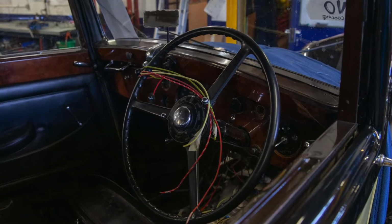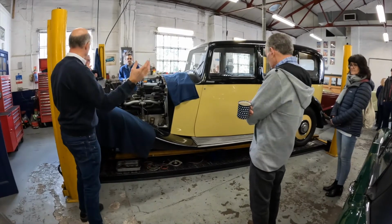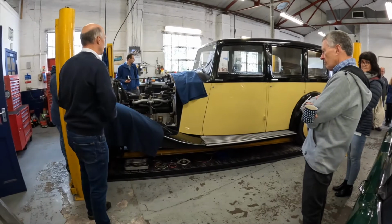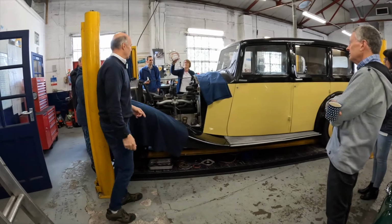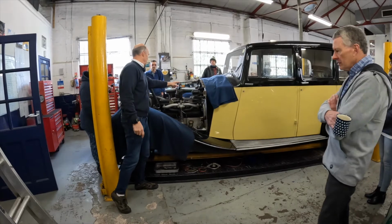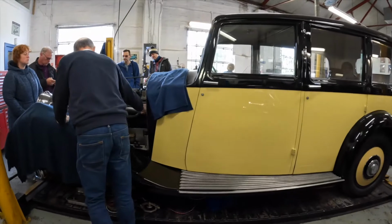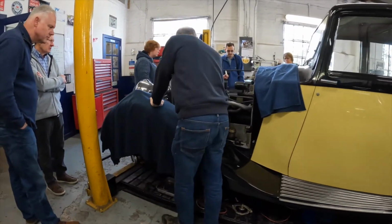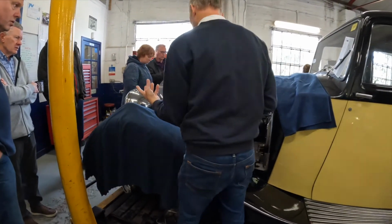And the wiring loom for this comes in sections of cable. There is no proper loom as you would know a loom in Healeys or your TVRs. Every single cable is cut to length and run. So you'll see, same with that one, capping across the bulkhead and down and round. That's all the cables run up in here and across. It's wired at the connectors with Ross Courtney terminals. So they look like a star. I've probably got some on the bench there you can have a look at.